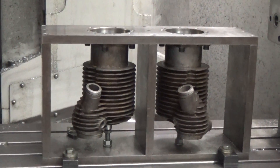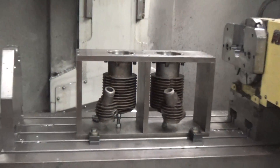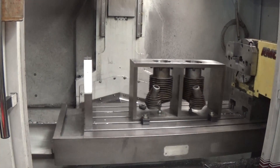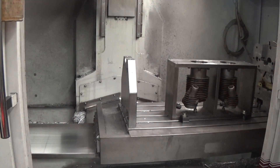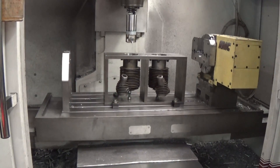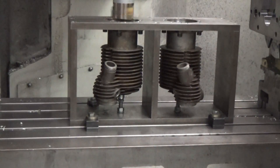I've got the sleeves in and I'm just going to take a first cut. That's just a close-up of the fixture. Now I'll start the machine — I've got to get the right key to this. This is only about a ten-thousandths cut, but it gives you an idea how nice this fixture and mill combination works out.